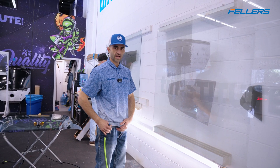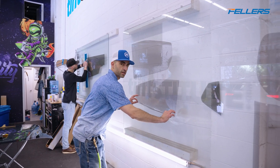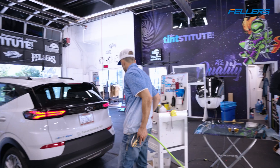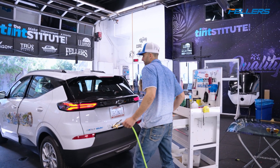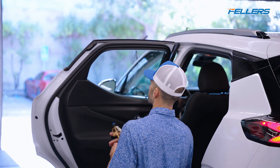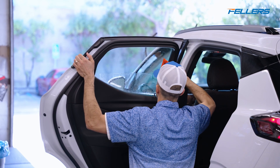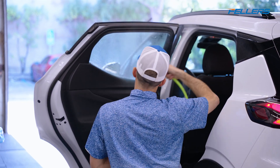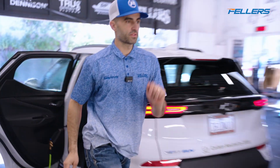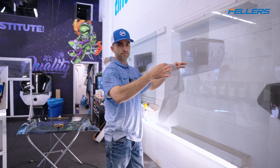The second reason why I have this upside down is so that when I'm ready to go over to the car, I can pick it up from the bottom, which actually is the top. I'm going to use my TrueSpray system to do my final squeegee — I just need a light mist. I'm using my Orange Crush that I got from fellers.com. Now I'm going to do my final spray; I like the TrueSpray system because I can push contaminants back on the sides. Then I grab the window film from the bottom, which actually is the top, and it falls right into place.